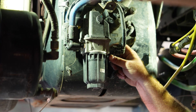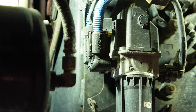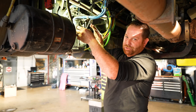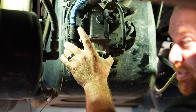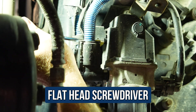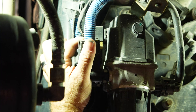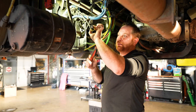It's the same process on both coolant line sides. On the DEF side — the blue lines — you have these two white tabs. All you do is take your finger and pinch them together, then wiggle and they come right off. I did take this one off just to show you — there shouldn't be any DEF except maybe a few trickles. Slide it back on and listen for a click. Then there's also an electrical plug up here. Use your screwdriver at an angle and slowly wiggle it down. It'll come out — just remember there may be road debris and salt on it, so wiggle and work it free.